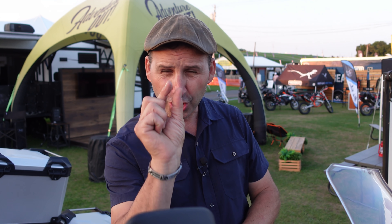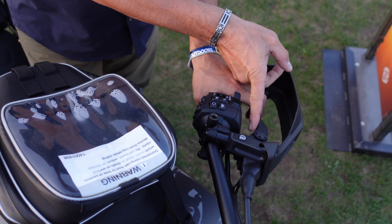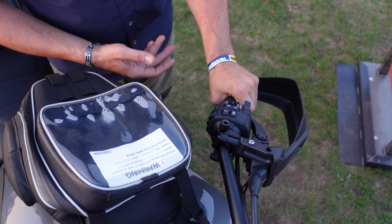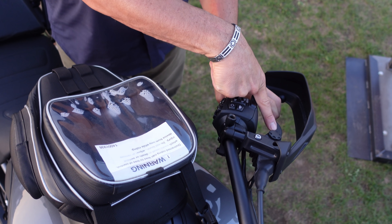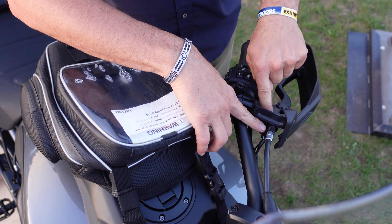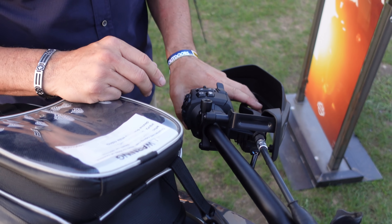The clutch play on the bike has a lot of range to it — it's not a really short friction zone. It's pretty broad, which for me I prefer a narrow range as it makes me feel more precise and I don't have as much throw when I'm off-road. But for a lot of riders riding these bikes on the road, or if they're very new to adventure riding, that's not such a bad call. Harley has an adjustment on the lever which allows you to get the throw where you want it — you can get proper two-finger control on this. It is cable actuated, so you can also adjust it at the clutch area and get just the perfect engagement.